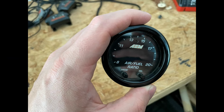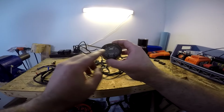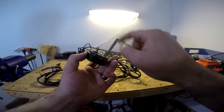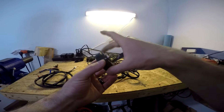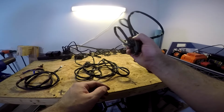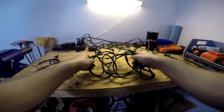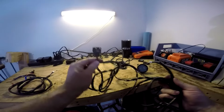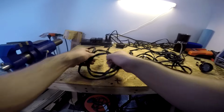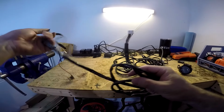It is by AEM. I will put a link in the description, and in that kit you get the air-fuel ratio gauge. This little metal bracket doesn't come with it. I put that on myself to mount it to the bike, so you just get the gauge portion of it. You will also get an O2 sensor along with it. You will also get a data cable that connects to the sensor and to the gauge unit itself. And then you will also get a power and data logging cable.